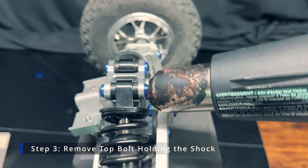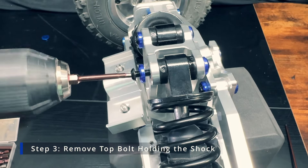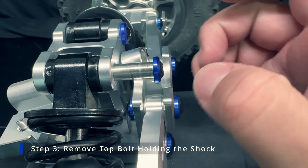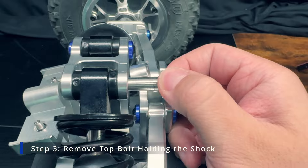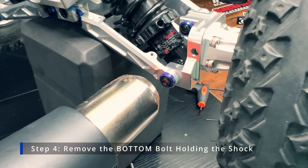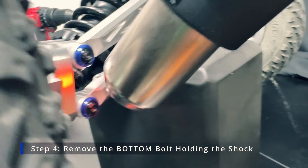How it works on these trucks is that there is a bolt with two screws on each end. All you need to do is remove one screw, then you can push the bolt out from the other end without removing the other screw. Remember to apply a lot of heat so the glue melts and you won't strip your screws. It's the same on the bottom as well, though the pin there is a little bit longer — apply heat to both ends.